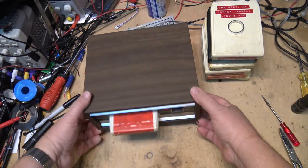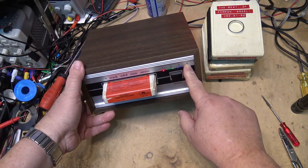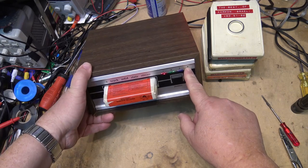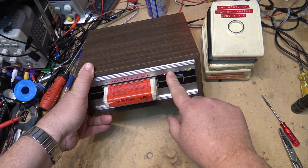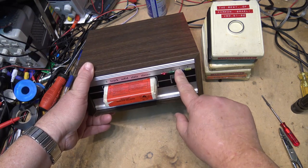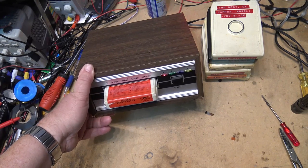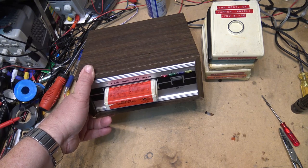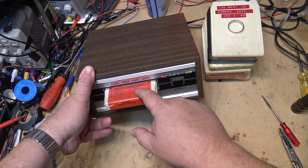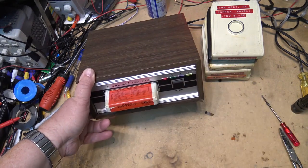So there's four programs. You've got track one, track two, track three, and track four. The full albums were typically broken down into two tracks per side for a record album. So track one and two would typically be side one, track three and four would be side two. Now sometimes they had to rearrange the music depending on the length of the tracks so that they would fit. And in some cases they actually couldn't fit them, because typically you were dealing with a 10-minute loop of tape, and that loop of tape went around four times, and that was your 40 minutes of recording.